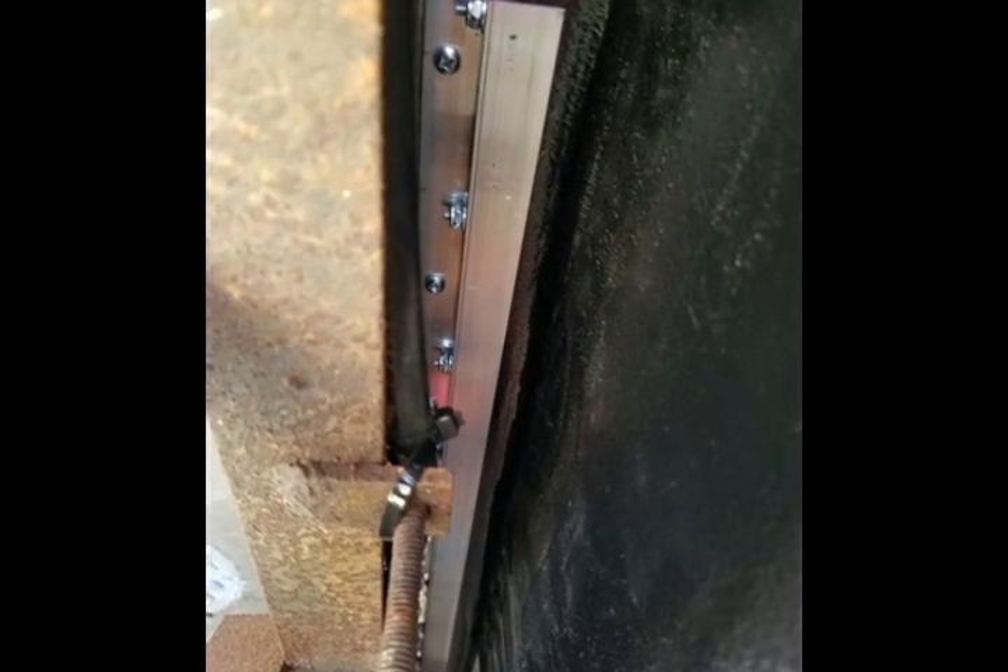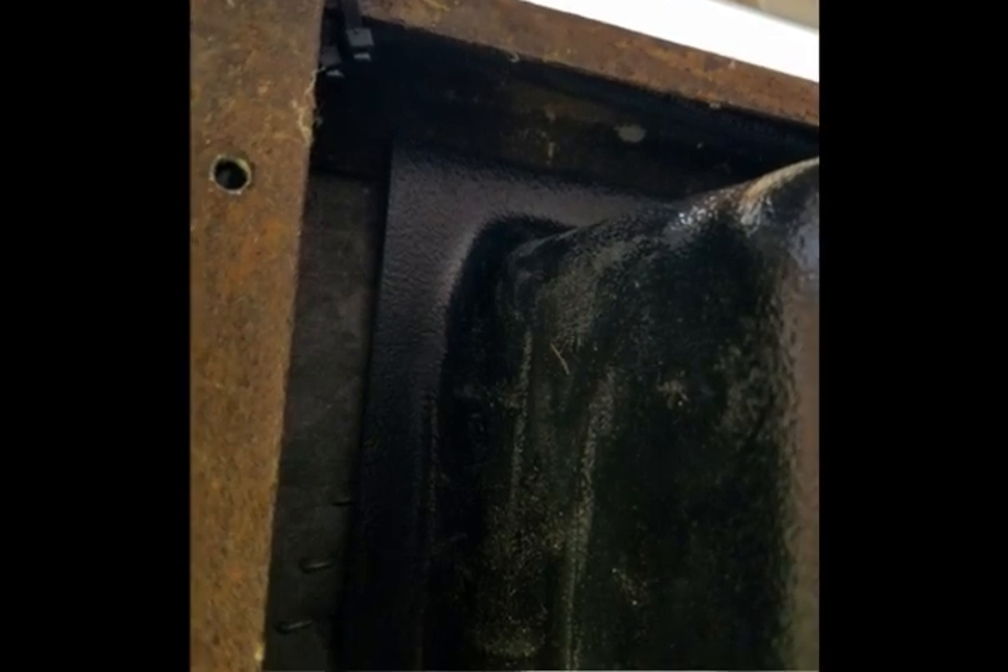I made these braces out of aluminum — two L-shaped braces. I put some screws together and was able to catch the lip. This is a new 31-gallon black tank made with ABS plastic, and you can see where it's falling into place. It's a perfect fit, gets right in there between the floor. It actually sits a little higher than the original one. You can see that little L-bracket I made, barely visible past the leaf springs and the frame.